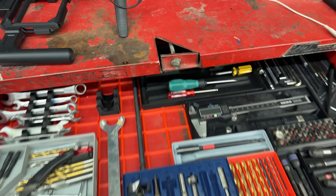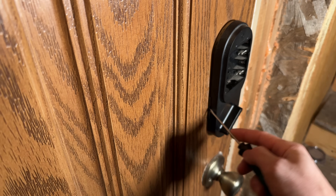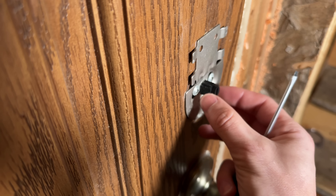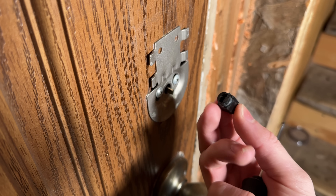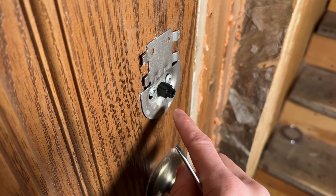It's been about four days since we originally installed that little pin, and I thought we should take a look at it and see if we need to replace it or if ABS is going to be the answer for us. Upon first glance, it does look like our ABS pin is not holding up so well — it looks like it's cracked basically in the same fashion that the original one did. It is still working and does still unlock and lock the door, but we want something a little bit stronger than that.